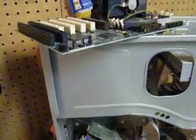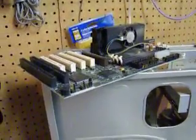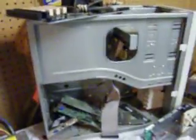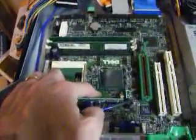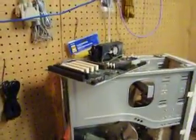If that motherboard were to blow, the power supply in a standard case — when I got my hands on it — was a 350-watt. So that Celeron 300A and motherboard could be swapped out for a Pentium 4 2.6 GHz or something like that with a gig of RAM. Not only have you fixed your old computer, you've also significantly upgraded it. There's no technical reason why you cannot do that in a standard case with a standard motherboard and standard components. With the Dell, you spend about the same money replacing just the motherboard, but you'd still have a Pentium 3 1 GHz. In the standard case, you'd have about ten times the extra computing power for the same price.